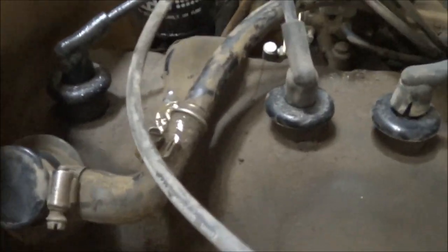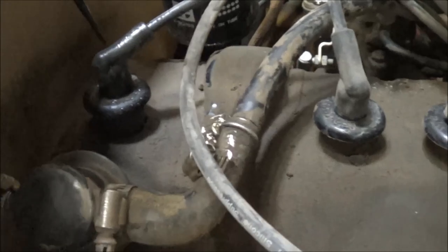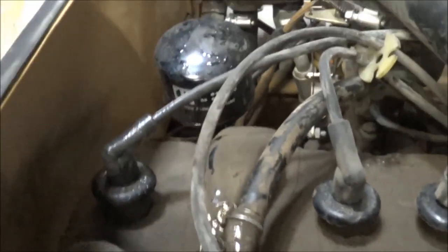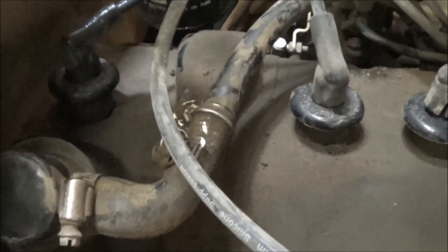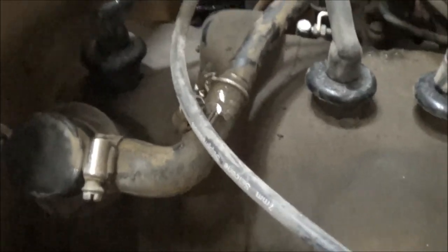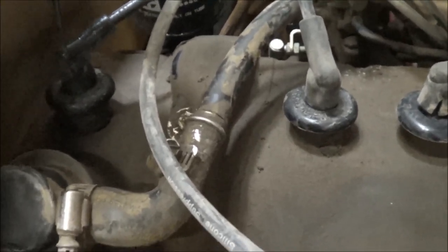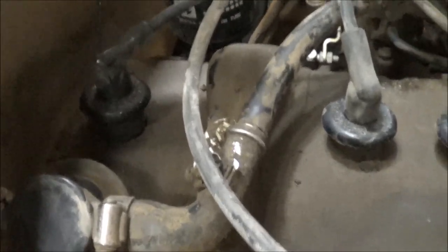Okay, here's one more shot. This time I put the plug wire back into the faulty cylinder and it's actually running better right now — you don't hear that misfire. I was concerned that maybe I just wasn't plugged in properly and it wasn't reaching the spark plug, because you've got to be careful with this type of system. Sometimes you think it's all in, but it's not reaching that spark plug. So I hooked it up back again and now it's running quite okay.